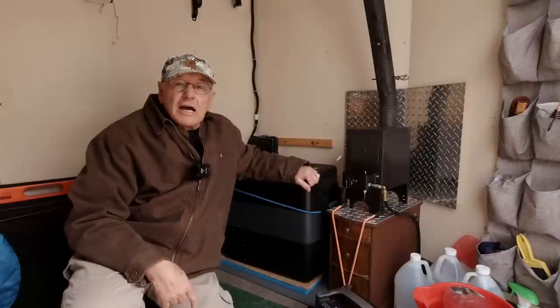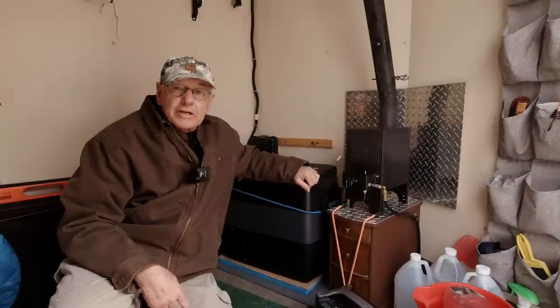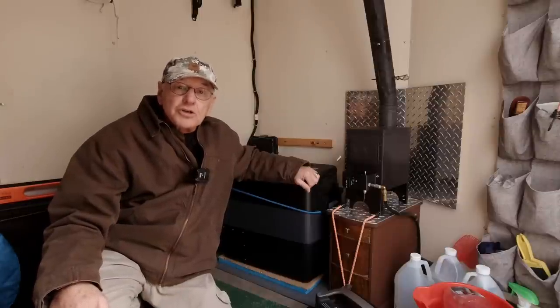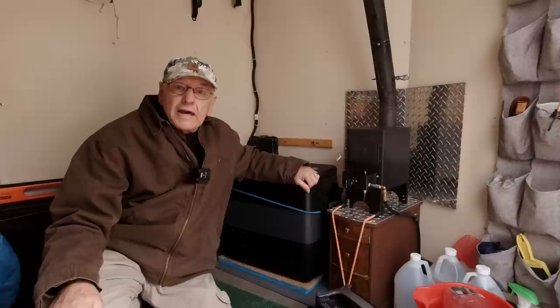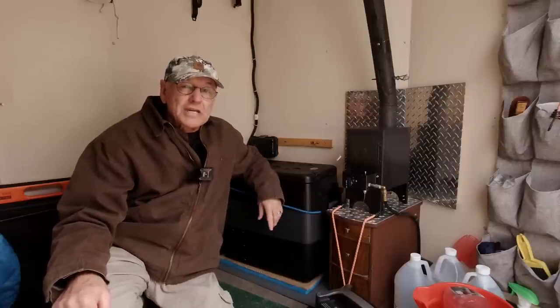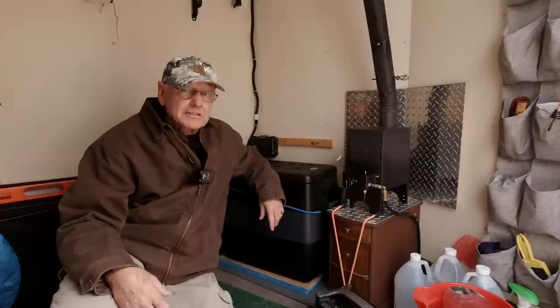You have to think about one thing though. In your house, how many times has the compressor gone out on your refrigerator? A refrigerator is the most dependable piece of machinery that any of us own. We buy a refrigerator, we plug it in, and 20 years later, it's still going 24 hours a day. When it does go out, it's seldom the compressor. It's usually that it lost Freon or lost refrigerant, or that some of the electronics went bad. And my feeling is that with these 12-volt compressor refrigerators, it's not likely to be the compressor that goes out. It's more likely to be the electronics. And even the refrigerators with the good compressors, the Danfoss compressors, have the same electronics.